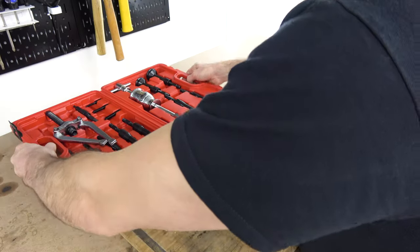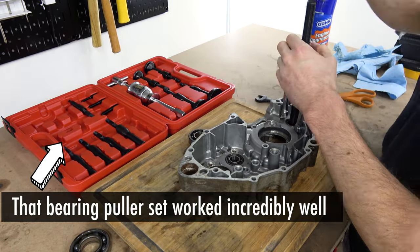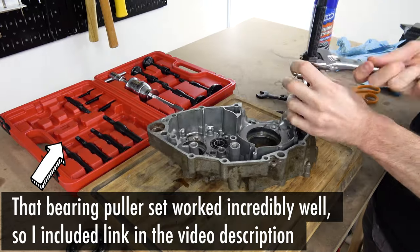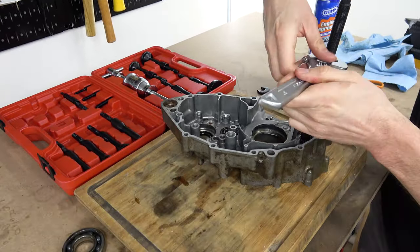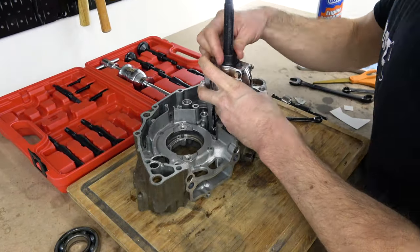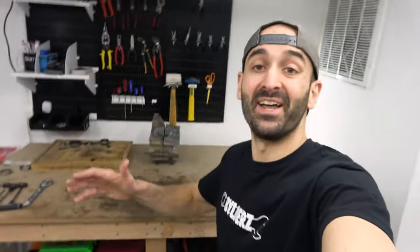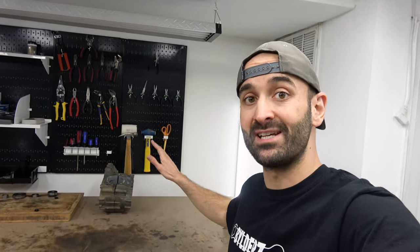And now to finish on the crankcase, we need to pull the bearings out. And I just cleaned the crankcases in my bathroom slash paint booth. I just went with a brush and some degreaser. I could have gone the vapor blasting way, but it's gonna be another $100 on the rebuild. I think it's not worth it. Structurally, they're really good. There are no bad surprises on those crankcases.